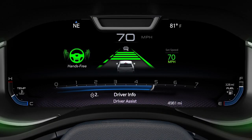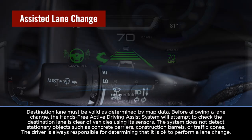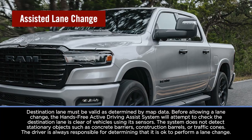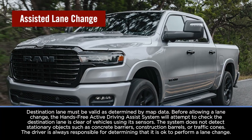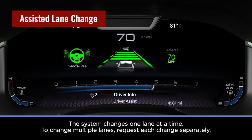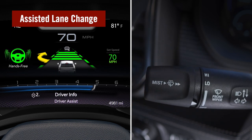When ADA is in hands-free mode, activating the turn signal requests an assisted lane change while staying in hands-free mode. Sensors, including blind spot sensors and map data, check if a lane change is possible. A dashed green lane line graphic indicates availability. If the turn signal is activated and a lane change is available, the system will start the lane change, showing a green lane change arrow until complete. If a lane change isn't available, a yellow lane change arrow graphic will appear while the system continues to search for an acceptable time to change lanes.